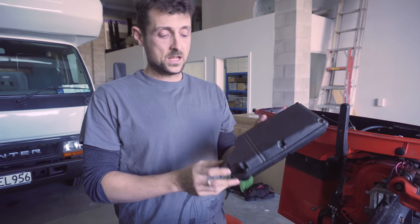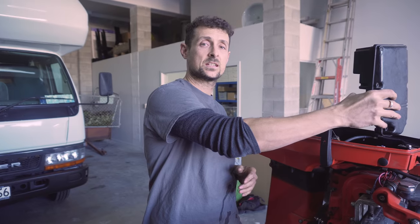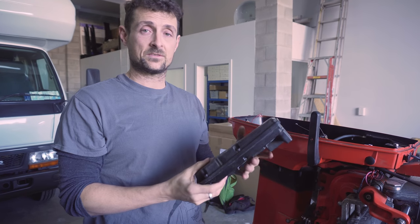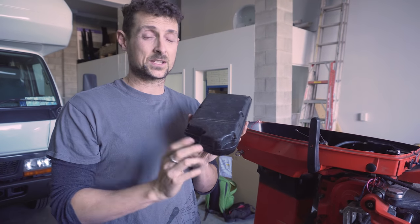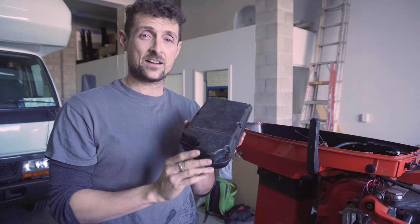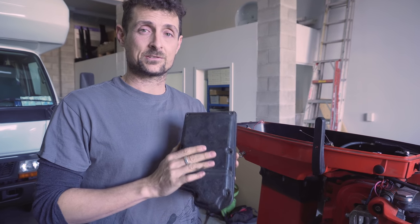The next thing you want to do is drill a small hole in the bottom of your airbox, which normally sits at the front of the engine. That's just to let the water drain out after you've submerged your engine. A 6mm hole is the biggest drill allowed, so I recommend drilling a 5 or 5.5mm hole, because if you go any bigger than 6mm — even by accident — you won't pass scrutineering.